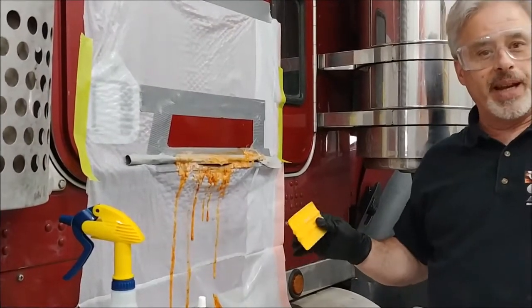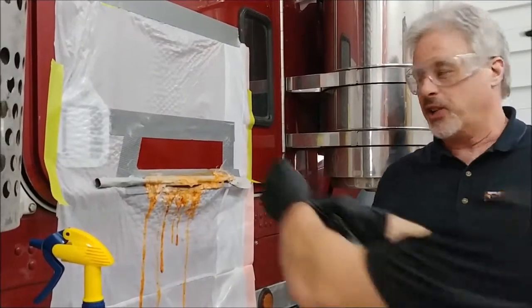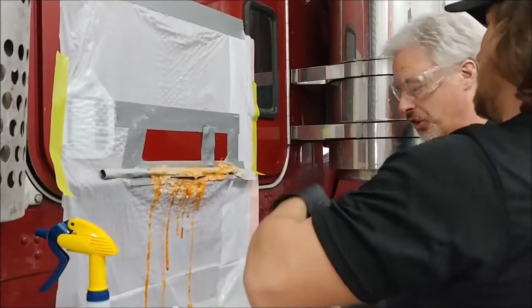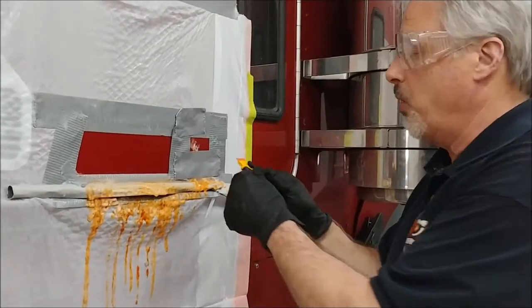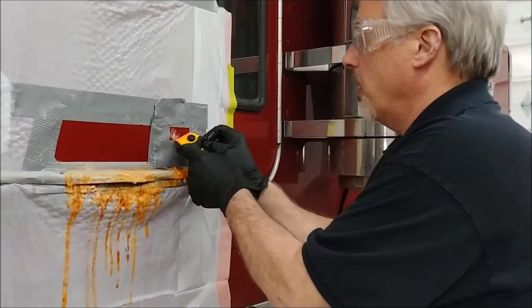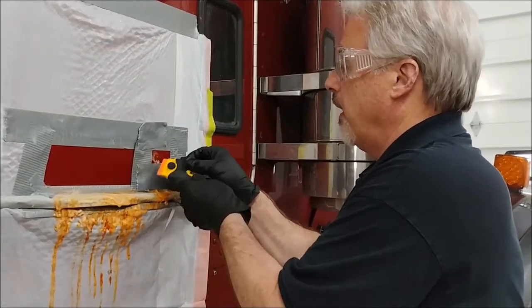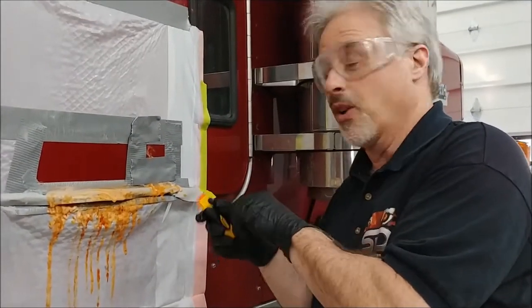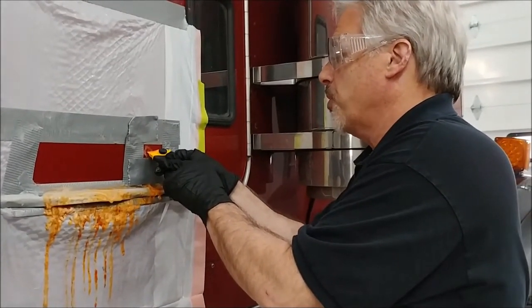So as you can see, this is the basic process for removing lettering with oven cleaner — a lot of caution required. Make sure you're just taking the paint off. We've got to isolate down to that one little brush stroke that was super heavy. Neutralized everywhere else — we've still got to be quick. Coming in with a plastic razor to do a little scraping. We softened the orange but we also softened the burgundy truck paint, so we've got to still be really careful.